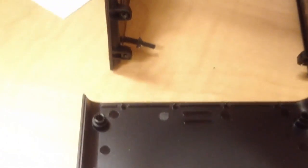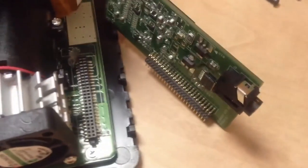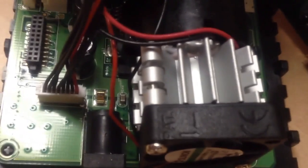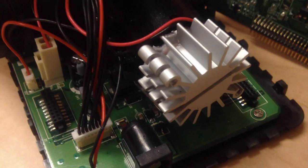We have the front off. The back, lens cover screws, and screw covers are the little rubber pieces. The RCA connector board has a cable on the back — I'm just going to leave that. The next step is to remove the fan and the heat sink, which is held on by a spring that I'll pop off with a screwdriver to reveal the LED.